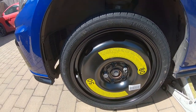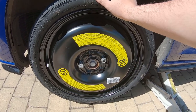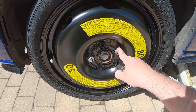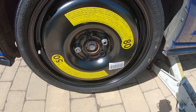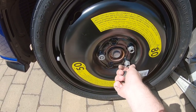When putting the other wheel back on — the space saver looks a bit odd but it's a similar process. I make sure it's flush on the hub, then I put one bolt in and then two bolts opposite each other. That helps push the wheel in so you know it's centered, and then you can run the other bolts in with your fingers.